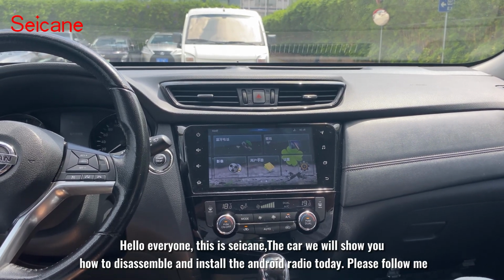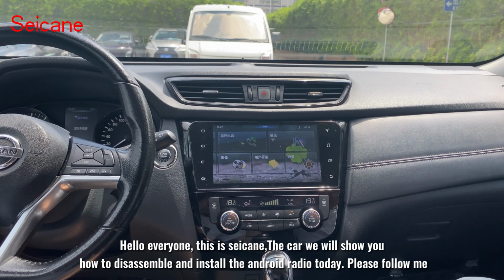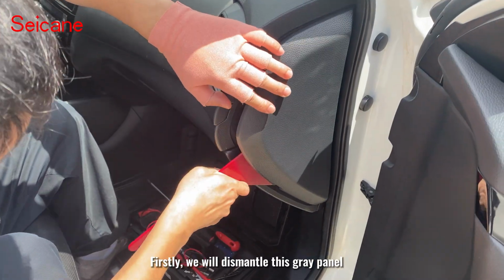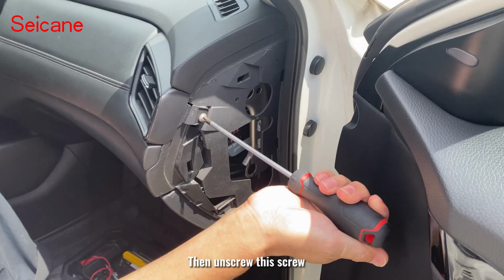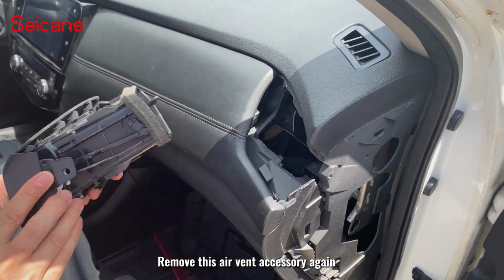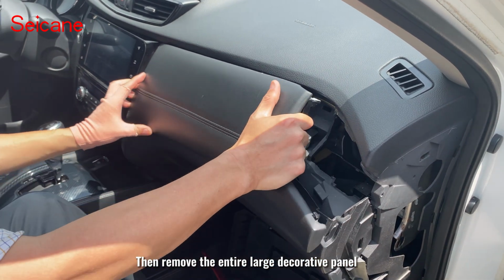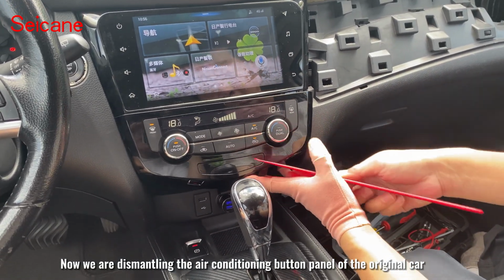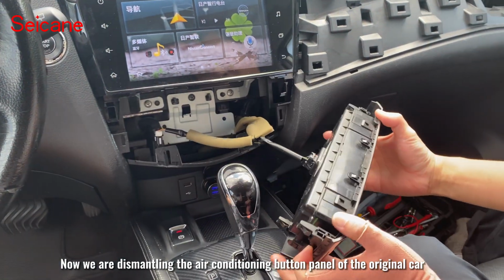Today we will show you how to disassemble and install the Android radio in the car. Please follow me. Firstly, we will dismantle this gray panel, then unscrew this screw. Remove this air vent accessory again, then remove the entire large decorative panel. Now we are dismantling the air conditioning button panel of the original car.